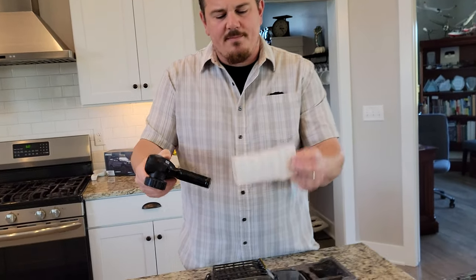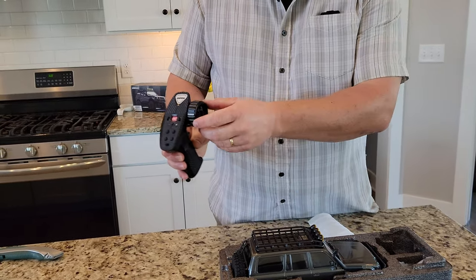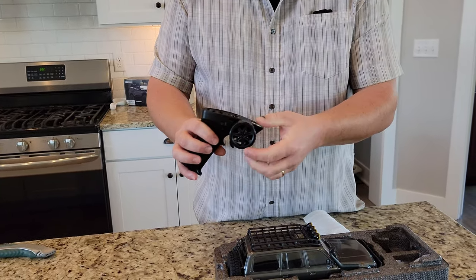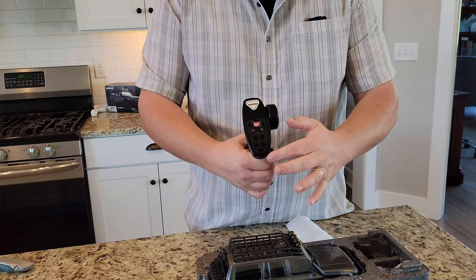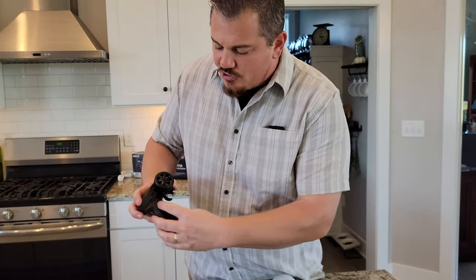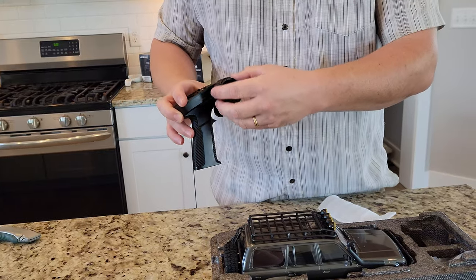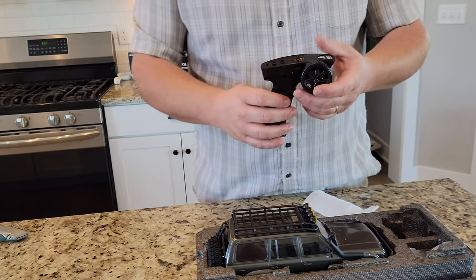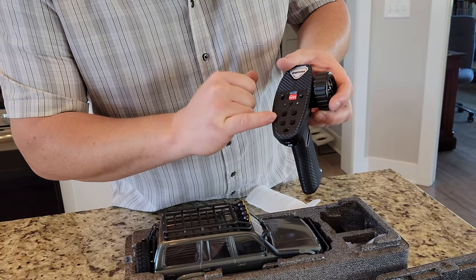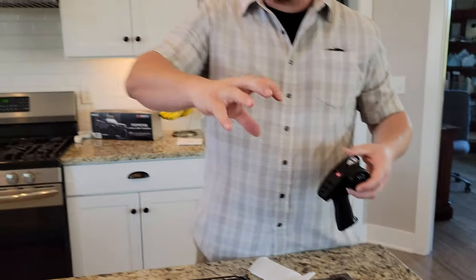The pistol grip is protected by its hood, which is nice — which looks amazing. We've got the standard pistol grip, no texture on here, just a little bit of traction. I do like the non-covered style so you don't have to break things off. Channel four is a push button momentary, and then a three position switch for channel three. Then of course we have the steerable steering — you'll want to change your steering dual rates to the highest output so the steering wheel commands maximum throw. We'll show you that in a few minutes.